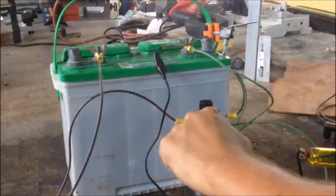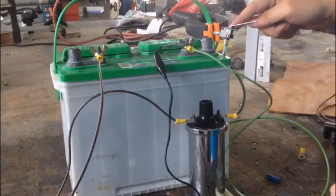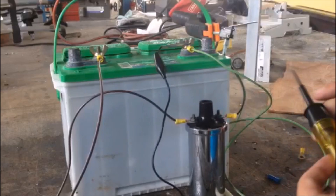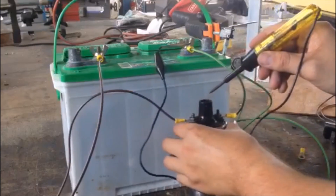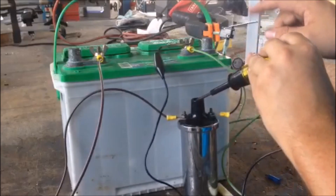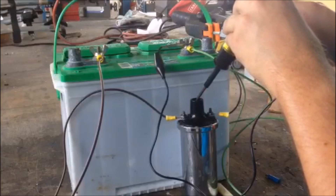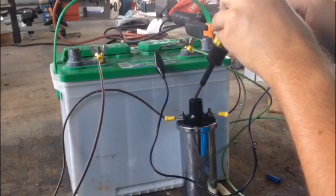This test light that I hooked up to the negative — I'll be putting it down on the output of the coil, and every time I touch my switch up here I'll be creating a spark. Due to the camera angle you're not going to be able to see it, but you'll see I'm holding the test light and you've got to get a gap, just like a spark plug. You don't want to just touch the contact — you want to create a gap. And every time I touch this microswitch, there is a spark shooting in this coil.